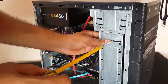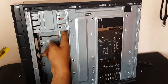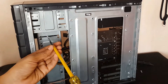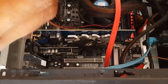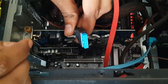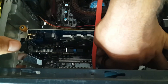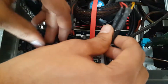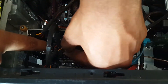Fix the screws on both sides. If your card is visible with four screw holes, fix all four screws. I have only two visible screws. This is the 20-pin male connector which comes from the front panel card — connect this to the female socket on the card. Now take a 4-pin power plug and insert it into the card. If you don't have such a plug, buy a converter adapter from local stores.